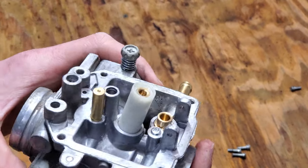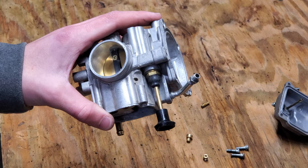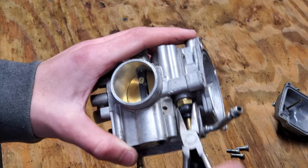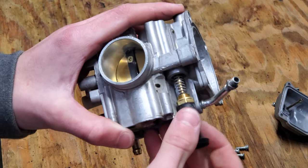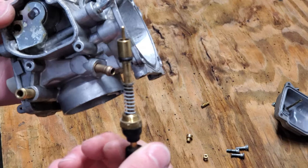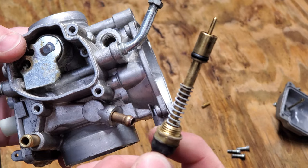I'm going to go outside and spray this whole thing off. Now that I have everything cleaned off, there's one more thing I want to check and that's the choke. In order to get the choke out just take off this nut here — it can be a little bit tricky to get to but this one wasn't on too tight so I was able to get it with pliers. You can see it pops off, then you pull this right out and there's an o-ring on there that you don't want ripped or lost. Inside of there is a bit dirty so I'm going to go ahead and clean this out with carb cleaner and spray it off with compressed air.